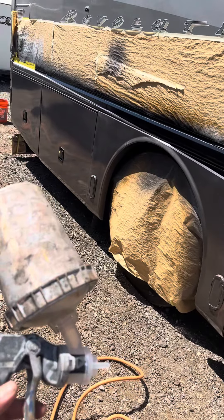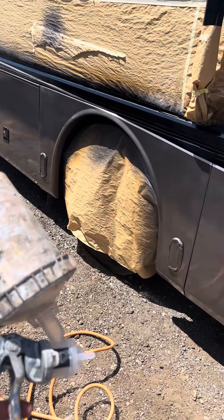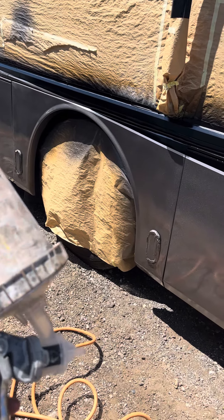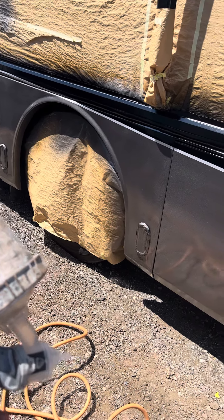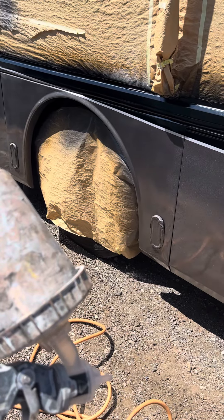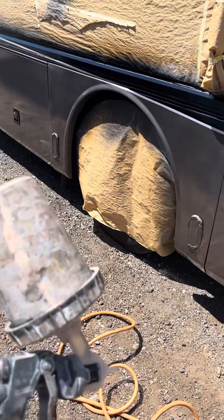I usually do go a little higher — so 20 PSI, maybe lower when I first mix the clear coat. The clear coat is mixed 50% reduced, so it's even more — 60 to 70% reduced on the first pass. The reason I do that is so that the atomization is so tiny.